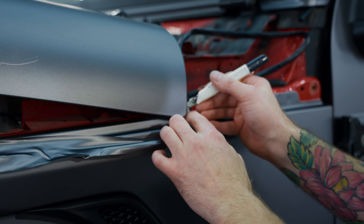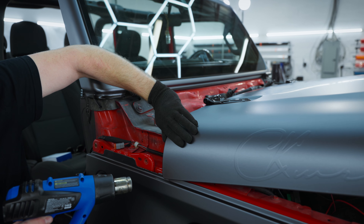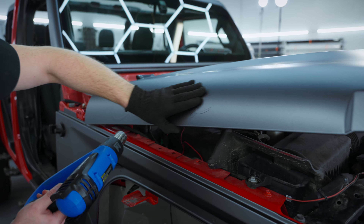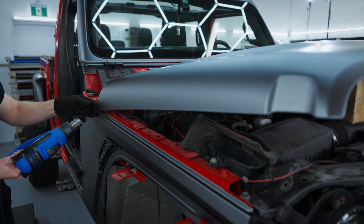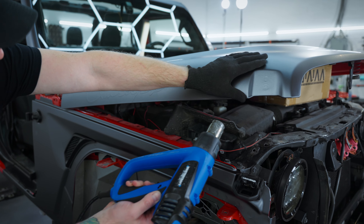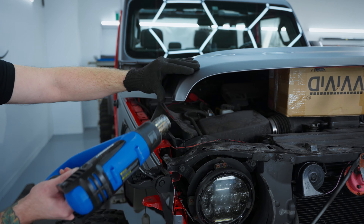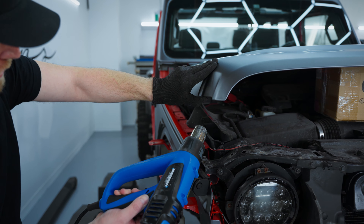Last thing is to cut off here. I'm doing a pressing motion — I don't want my finger to drag on the edge. You can slide as long as you don't heat too much, but if you heat too much and slide, even with a glove on, it's going to drag and you'll end up with creases or wrinkles. So sometimes when I see extra material hanging off just a little bit, I press instead of sliding. It's all about being observant and watching what's happening.